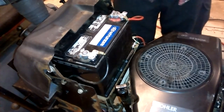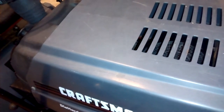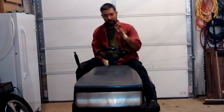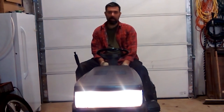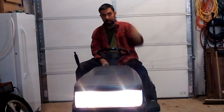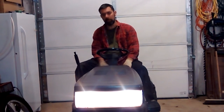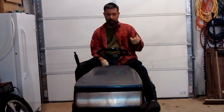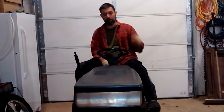And really, that is it. You can close your deck — fits in there just fine. What a simple mod! Very easy upgrade. Now I've got the ability to run my lights if I need to, keep those on and light up a work area if I'm working at dusk or if I'm snow plowing and need to get off the tractor. I can leave those lights on with the engine off. And while I'm plowing in the middle of winter, I'm sure that my mower is going to start because I've got a monstrous automotive battery with probably four to five times the cold cranking amperage of the original, and four to five times the reserve capacity.